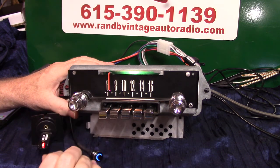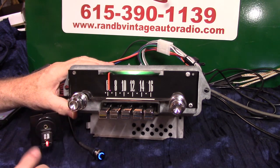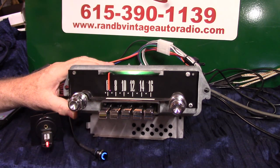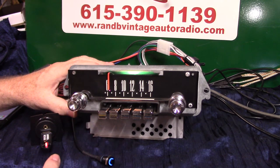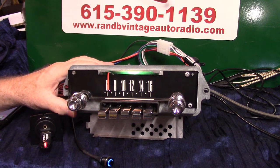Turning up twice summons the phone. You can go down to put this in pause — you don't have to take it out unless you want to charge the phone. Or hold this in one second — pause — and it goes right back to radio. The light will flash and cycle back. To go back to thumb drive: down twice, put it in pause, right back to radio. That's the cycling between modes.